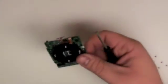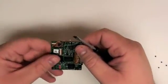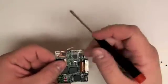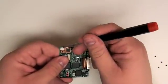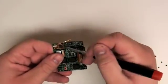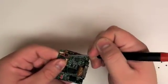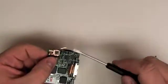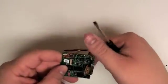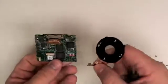Now set the middle frame aside. To remove the click wheel from the logic board, there is a lock bar that will need to be unlocked. The ribbon cable will be held on by adhesive, so gently pry this off with the logic board and the ribbon cable will come free from the lock bar.